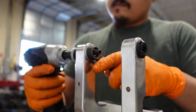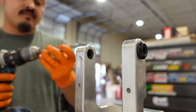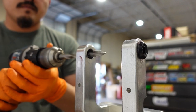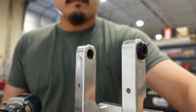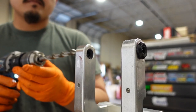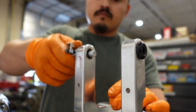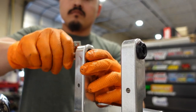If you get some small chunks of Delrin coming out, just pick them out of the way. These specific Cusco bushings end up out-of-round on the inside bore once they've been pressed into place. We've reached out to the vendor to make Cusco aware of this, but for now we need to ream the bore out with a 25/64 drill bit to get that inner diameter perfectly round again. Run the drill bit back and forth a few times, stopping periodically to check if your shifter base pins fit. The pin should slide in and out with one or two fingers.